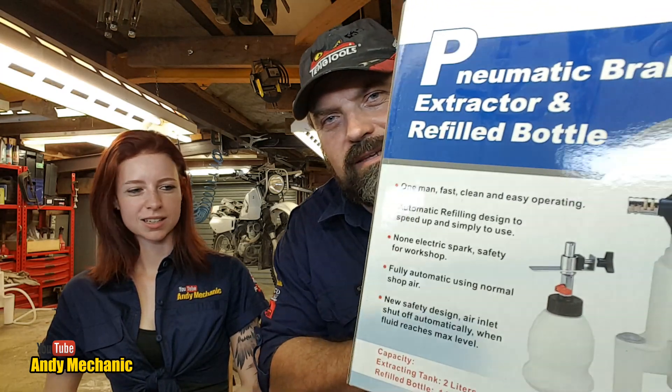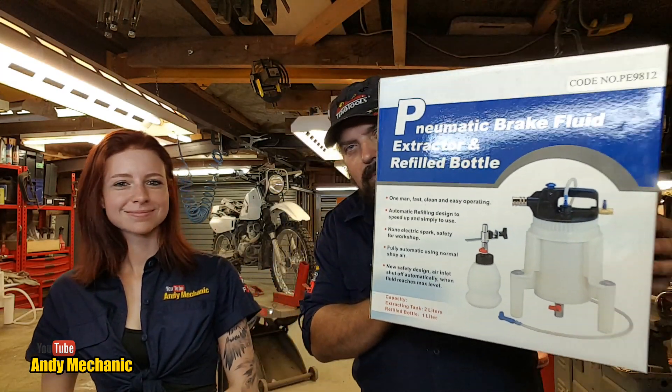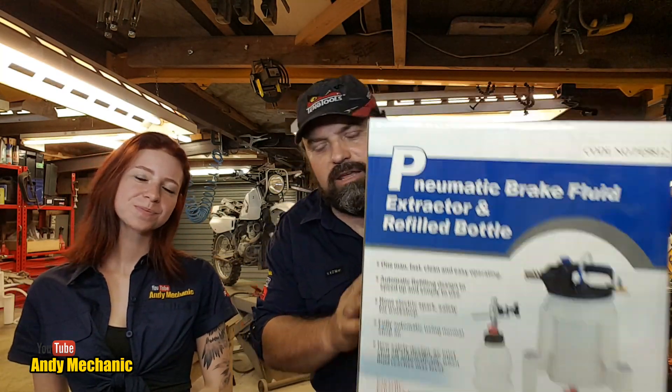Right, this video — we used to use this at college. It's one of those vacuum brake bleeders that uses compressed air from your air compressor to vacuum bleed the brakes on your vehicle. Really cool — this one sucks the fluid through. You can get other types that push the fluid through from the master cylinder. Both work pretty well. I've wanted one of these for many years; this is the first time I've actually owned one. I've used plenty in workshops and at Unitech where we taught how to use these.